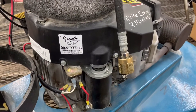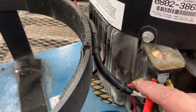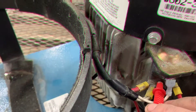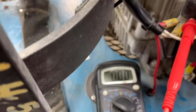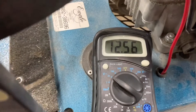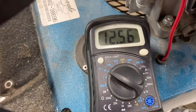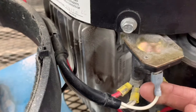What I like to do is start here at the solenoid where the main battery connections are, and just put your positive lead to your voltmeter, then go to ground. We should be getting battery voltage — and we do, at 12.56. All right, we got battery voltage.